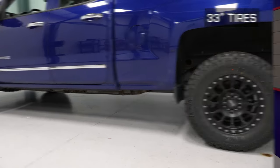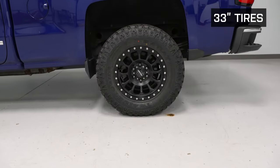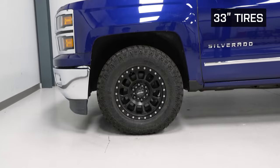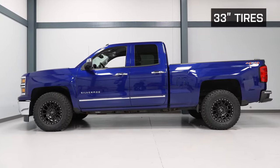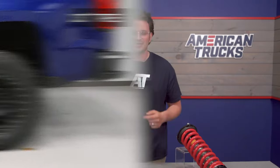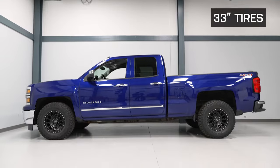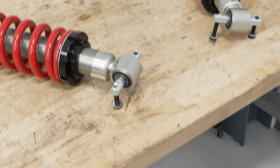This also opens the door for flexibility with running different tire sizes, which is a huge bonus. Sometimes you have a static lift set up and it fits great with 33s, and that's where front coilovers that are adjustable really shine. Adjustable front suspension is really the end-all, be-all way to buy once and have lots of freedom to continue building and customizing. These are going to ride and perform a lot better than a leveling kit that just plops on top of the factory suspension, since they're designed to ride and perform higher than the factory suspension.